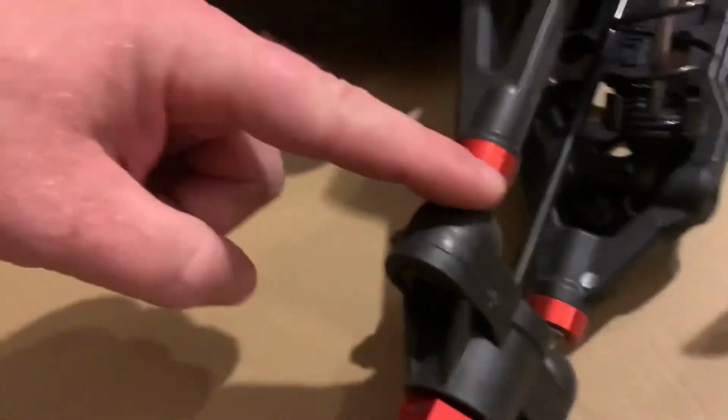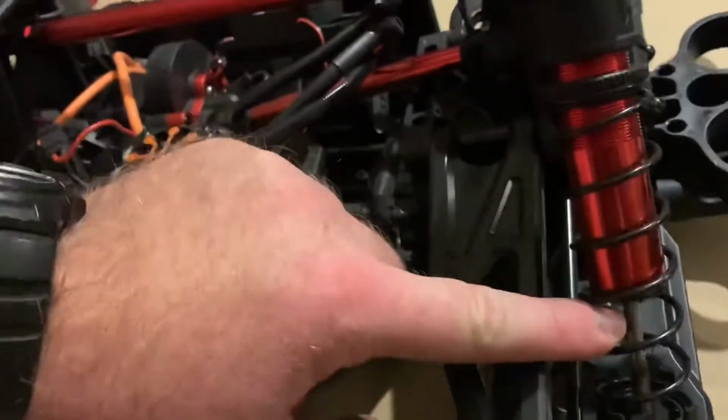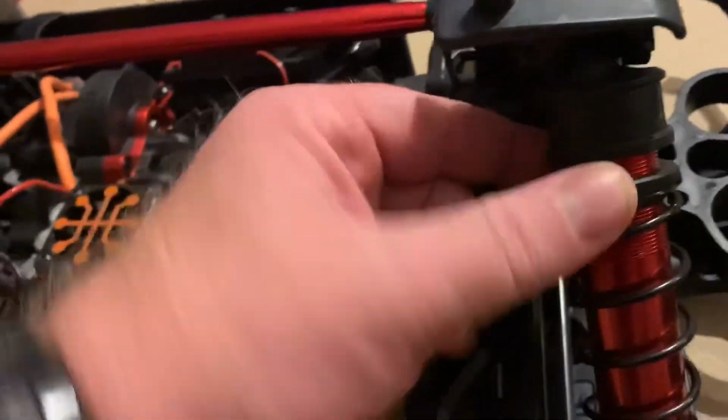You're going to be checking all the friction surfaces. You're going to be checking the ball lines. You're going to be checking the drive shafts for bends. You're going to be checking the shock shafts for bends, shock shafts for play. You're going to be checking to make sure the shock shaft's not leaking. If so, why is it leaking? You're going to check all the bolts and nuts securing the A-arm. You're going to check the hinge pin braces for tightness. You're going to check back here the steering arms, steering rods, all this for tightness on all four corners.